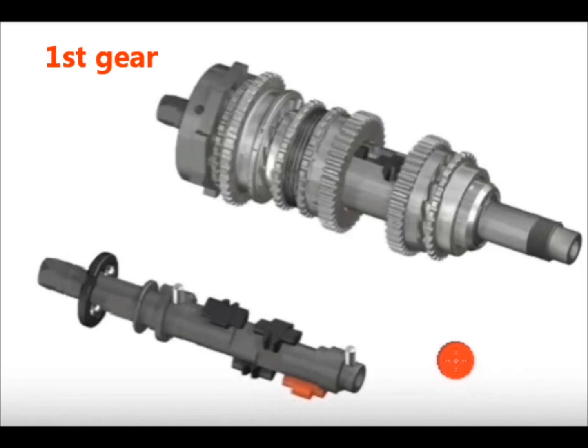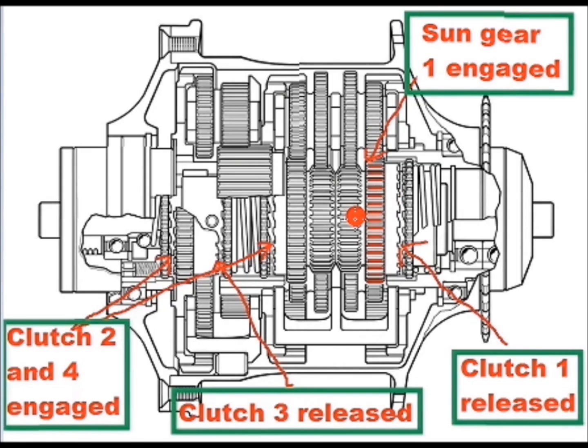Now we will see the engagement and power flow sequence through the first 7 gears, remembering that the sequence repeats for gears 8 through 14. In 1st gear, the No. 1 pawl rises, coupling No. 1 sun gear to the axle, making it the fixed reactionary component. No. 1 clutch is in the release position, allowing the No. 1 ring gear to rotate independently of sun gears 1 and 2. As the ring gear rotates, driven by the driver, the planetary gears rotate about the sun gears. As No. 1 sun gear is the one fixed to the axle, the ratio between the ring gear and planet carrier is 1 to 0.682.